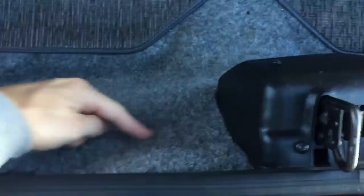It goes in through the back of the carpet — grommets right here — just running around. I tagged the reverse lights, and the AV hookups are right behind here. You can see it's going through the grommet right here. I tagged the reverse lights back here, but you could tag them up front too. I just figured since I was running it all the way back I might as well. Ran it all through the side kick panel, all the way back behind the rear seat — pretty standard stuff.